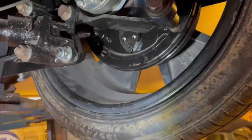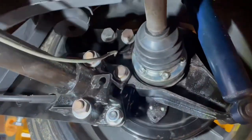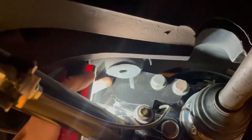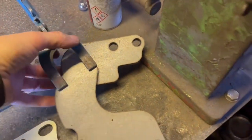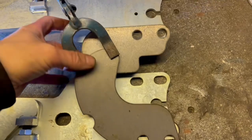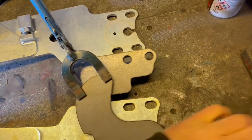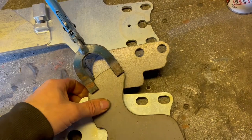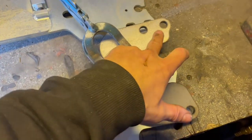If you have a lower shock like I have on this one — even if you're using stock — that wheel will almost fall completely down. The other thing I like is these horseshoes that sit in here. A horseshoe is like this, it sits on top like this on the spring plate. You can buy it in aftermarket and it makes your IRS arm go lower and the hub up here.